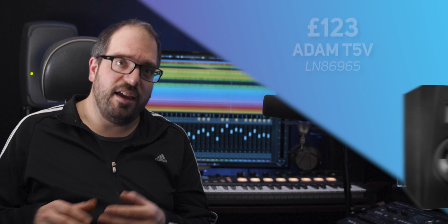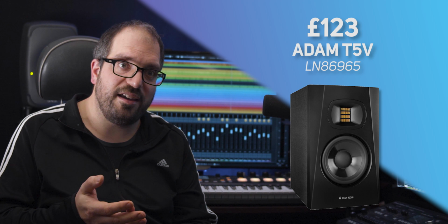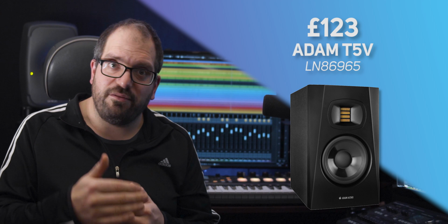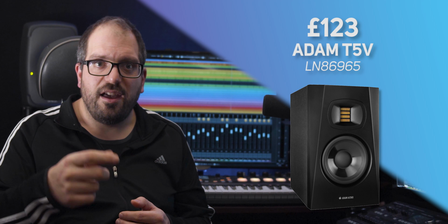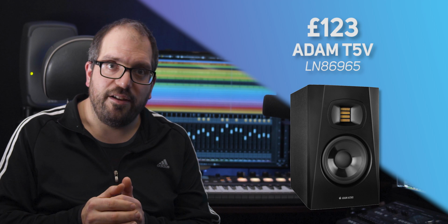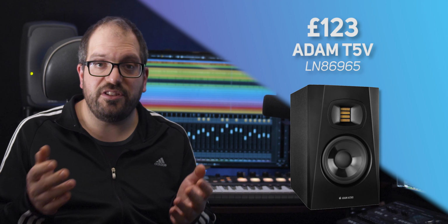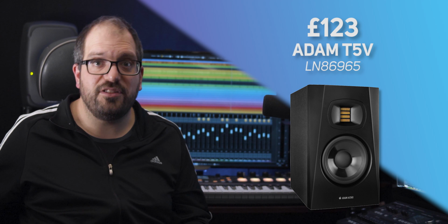My next choice on paper actually doesn't look that suitable. It's the Adam T5V. They've got fairly mild acoustic controls on the back, so they aren't suitable for going very close to corners, and they've got a rear firing port, so they really do need that 2, 3, 4 inch distance from the rear wall. And again, if you've got a little absorber panel that you can put behind them, so much the better. However, the detail and the balance on these is excellent for almost all styles of music and video work, and they've got a very healthy bass response too.